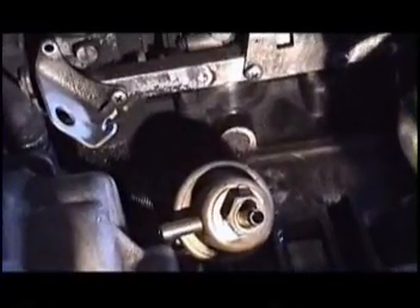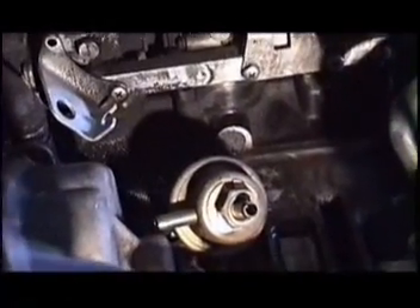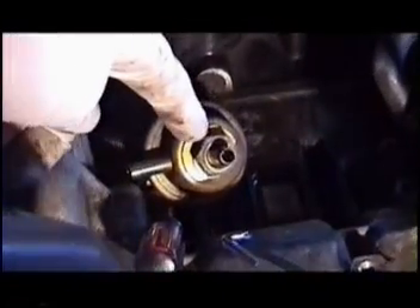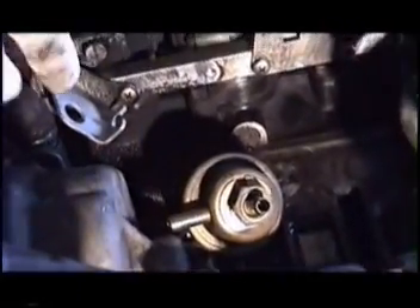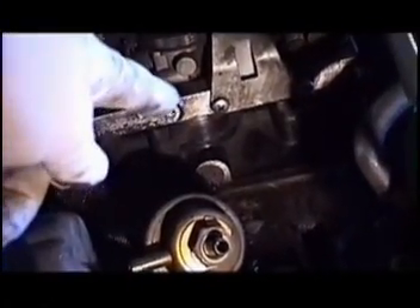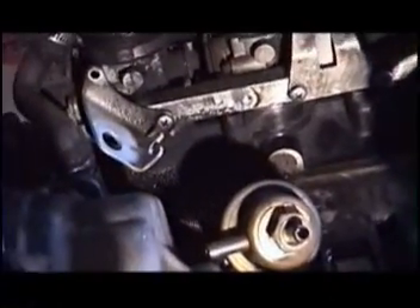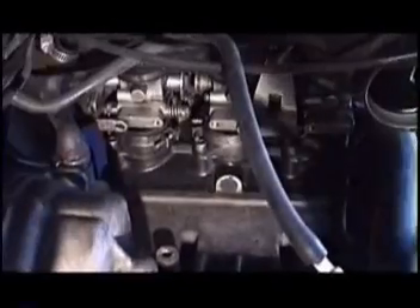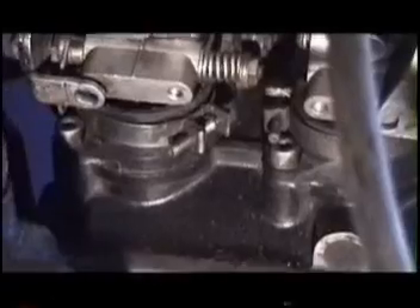The wire actually wraps around — I referred to my digital photo and that's how it works. I'm relocating the fuel pressure regulator; this is going to be located outside of the rail. I used a 19mm on this nut, which is really tough. The unit drops down a little bit, which allows you to get access to the second screw. It's better to leave the first screw in when taking that nut off. Next, unscrew the clamps at the bottom of the throttle bodies, but remember to mark their location — they must go back on exactly the same way.